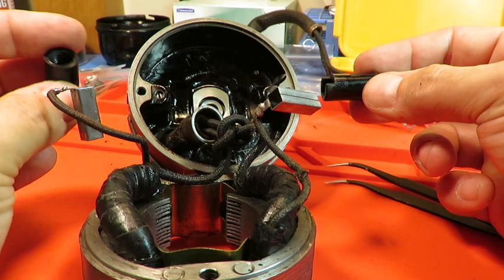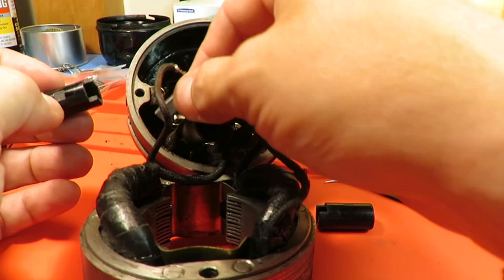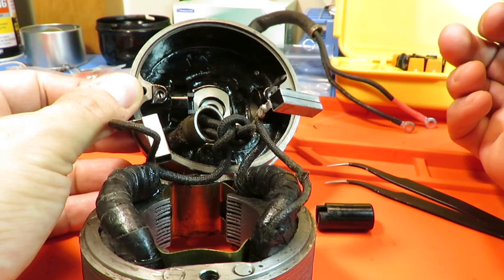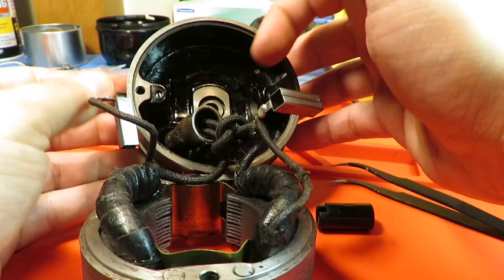And so the boxes come out inwards and the sheets come out outwards. And the reason they can't, when they're connected, you can't get them in past this central boss here. That kind of is obstructing any inward progress of the Bakelite sheath, and so they need to be separated in order to separate the housing from the field core.